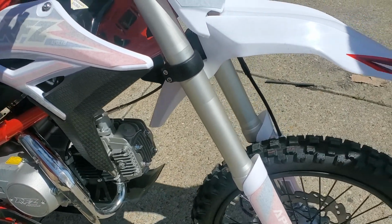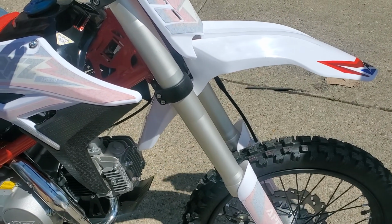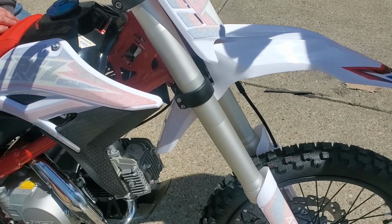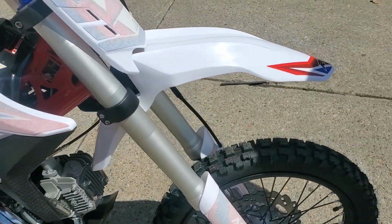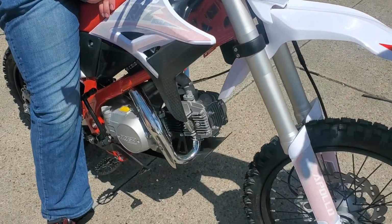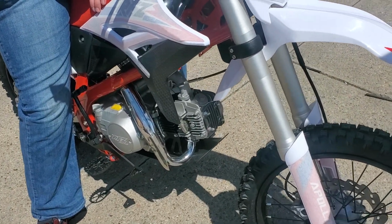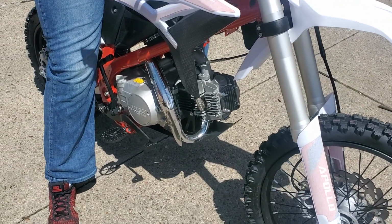Okay. That's if you're squeezing in the clutch and, like when I put it in first gear, it just sits there. If he puts it in first gear and it's wanting to start rolling forward on him, even with the clutch in, that means down inside the clutch isn't all the way open, so you can adjust it with that cable. So you just unscrew and bring it further out, spread it about, and then tighten back down again. Yeah. Okay. Yep. All right.